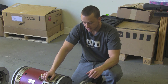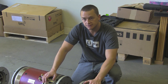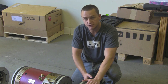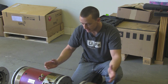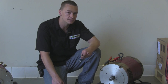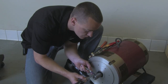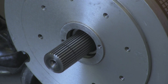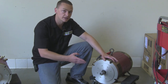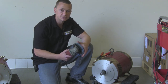One of the first things we need to do is cut these shafts down. They come pretty standard universal — about 3 to 4 inches long. Here at EV West we really like to make everything as compact as possible, so we actually have our inner motor flanges down to 3 inches. That means we need to cut these motor shafts down to just a little less than an inch and a half each, and then we can couple them together. I have my caliper set to an inch and a half, and I'm going to use a 12-volt battery to spin the motor shaft as I mark it with my permanent marker. Now that the motor is marked, we're going to use the same 12-volt battery and spin the shaft while we cut it, which will ensure a true cut all the way through. I'm just going to use a regular 4-inch cutoff wheel — you can get these at Home Depot.